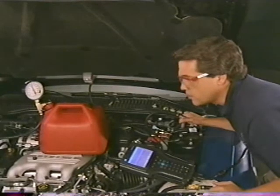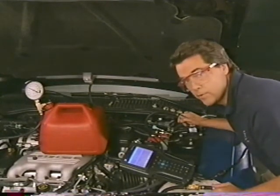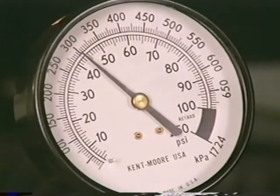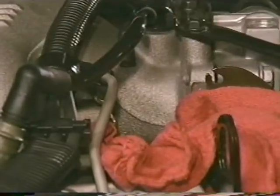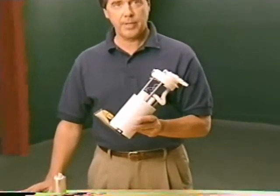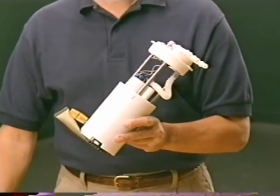Don't let the fuel pressure climb beyond 65 PSI, or you'll damage the fuel system components. If the fuel pressure rose to within specifications, it proves that the fuel pump is capable of meeting the system's needs — replacing the fuel pressure regulator should solve the problem. If the pressure still did not rise to meet specifications, remove the fuel sender assembly and begin looking for the potential problems explained earlier in the program.